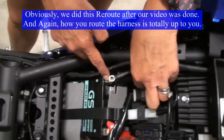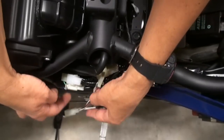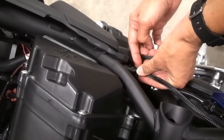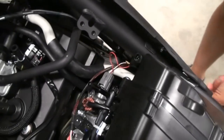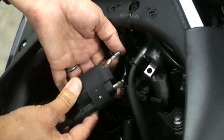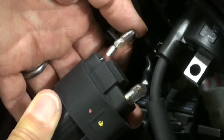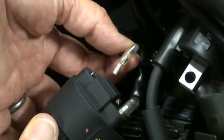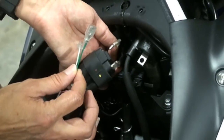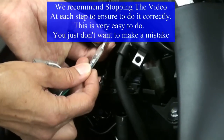Make sure you follow the wiring step by step — it's really important that you do. The wire going to the ground is on the battery, and there's a wire underneath the frame. Coming over on the left side, then down on the right side, routing underneath the air box still inside the frame — these are going to be your injector plugs and these are for your coils. First, unplug the orange wire from the left coil. Then take your Power Commander wire — the solid green — and plug it into the orange, making sure the boot covers it.